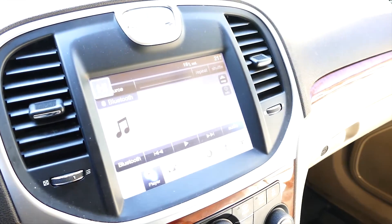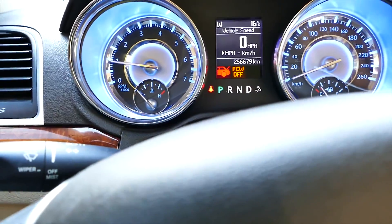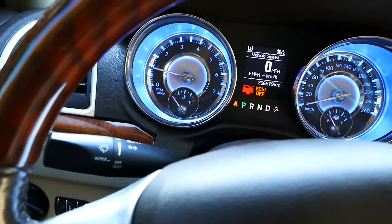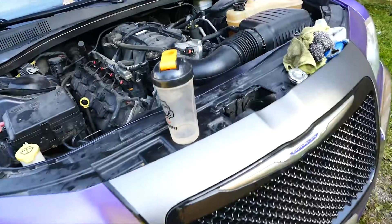Whenever I do anything with the coolant, I like to heat it up and run it in the driveway for about 20 minutes. I also crank the heat up and let the coolant go through the heater core. The reason I do this is because if anything catastrophic would happen, it would happen in your driveway and not on the road. We'll test drive this afterwards, but this is to check the heater core and make sure everything's running tickety-boo. Then look for any leaks while the engine's at operating temperature, which is a whole different ballgame. Set a timer for 20 minutes and we'll clean up.